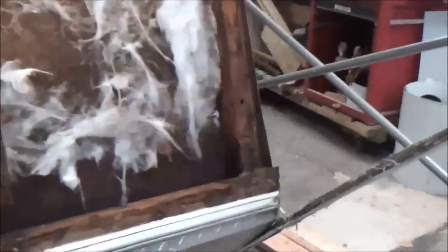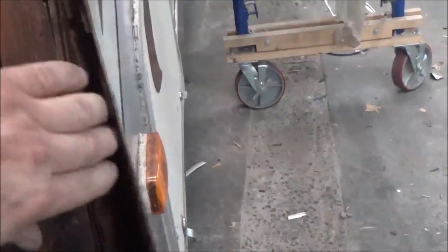This piece is rotted, that's rotted — we've got a few sticks that are rotted. We're going to stitch them up and get it back to where it needs to be. We've also got some delamination on this side which we can probably fix too — we can fix anything without having to tear it all apart. We've got a little delamination on this side as well. That's not terrible at all — we may be able to dry that out and relaminate.